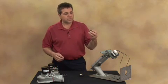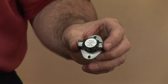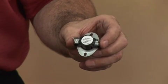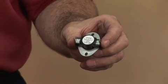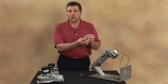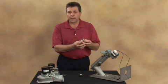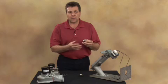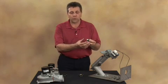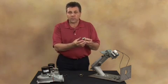One of the high limit sensors on the appliances is a 250-degree high limit thermodisc, typically white in color on the end, which indicates that it is a limit. This switch is typically in the closed position, meaning there is current going through it at all times unless the unit over-fires and gets too hot and the circuit opens up. If the unit does not shut down in an over-fire condition, take your voltage meter and check to see if it's in the closed position when it's cold.